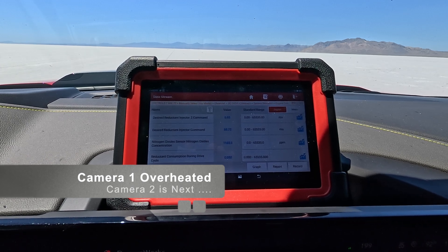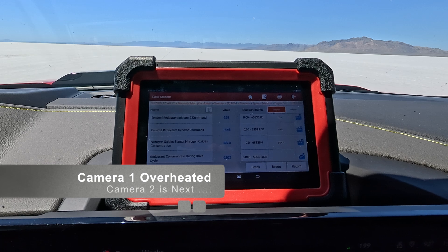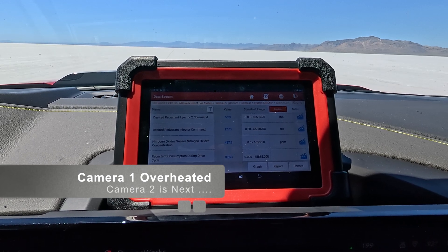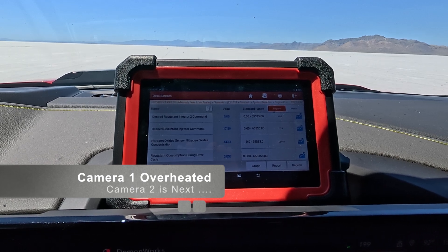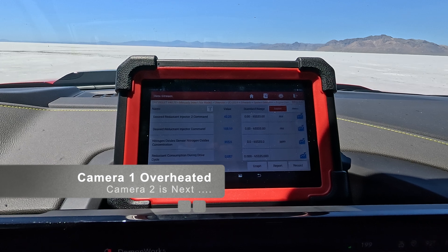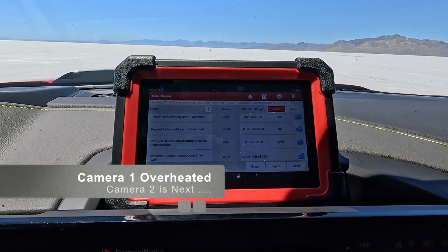Let's see what 55 brings us. There's our 55 miles an hour — it just clicked into the gear it's holding. We've got 14 to 15 for DEF injector one and DEF injector two sitting around six or so. I'm thinking DEF injector two did not come in until later on the previous run just because it wasn't ready, but not totally sure why. At 55 miles an hour, 17 to 18 reading for injector one and about five from DEF injector two. Bumping to 65 — you can see the DEF rate goes up considerably as we dump fuel to accelerate. We're sitting around 20 to 25 for DEF injector one, with injector two at around six and a half.